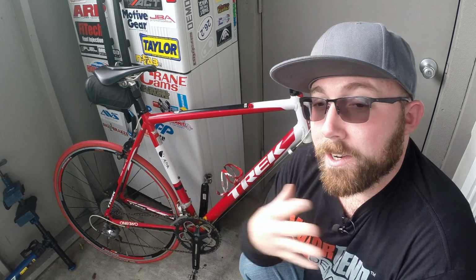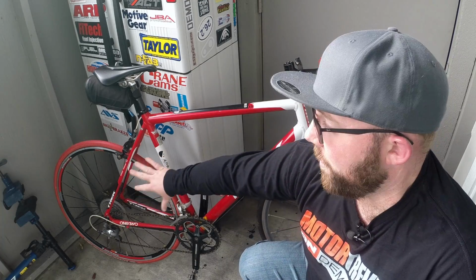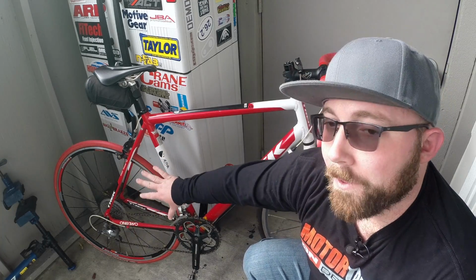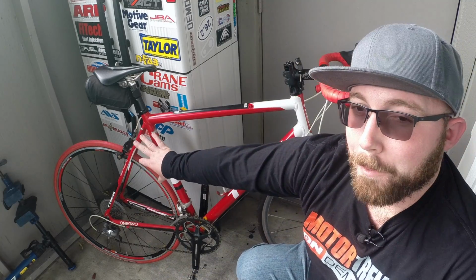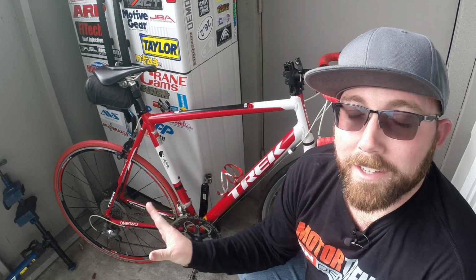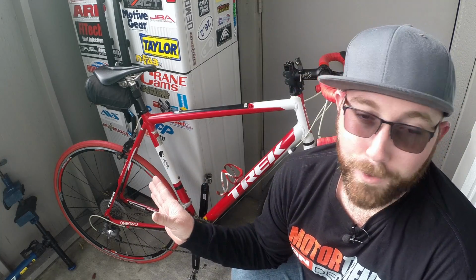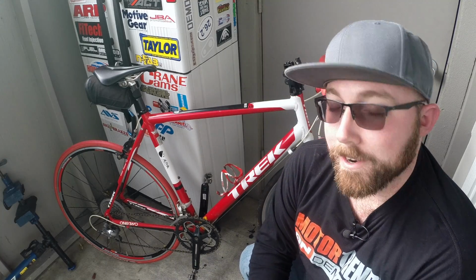One thing I like to do personally when I go on the trainer is change out my tire and wheel combination. Actually, I have a separate wheel to put this on, so it's easy, you just switch off, switch on. I actually do not put my brake back on tight. I leave it loosened so that it's not going to rub or cause any issues while you're on the trainer, because that can wear your pads very quickly as well. So that would be your basic setup if you're looking not to wear your tire out.